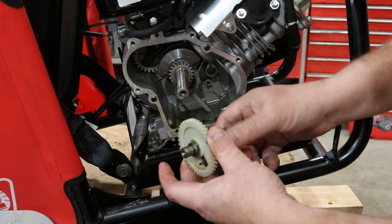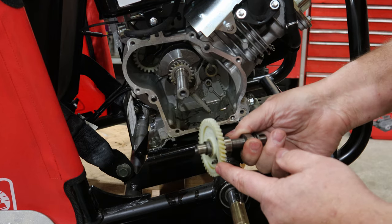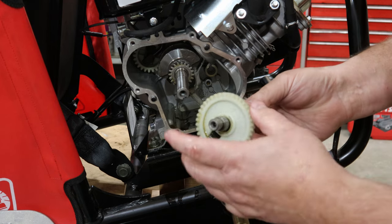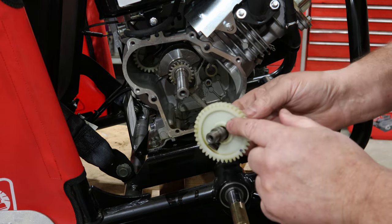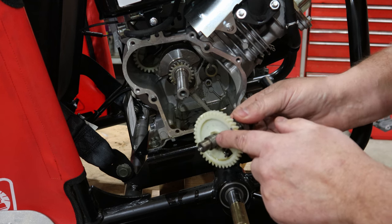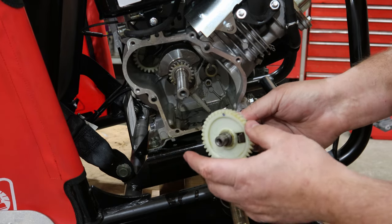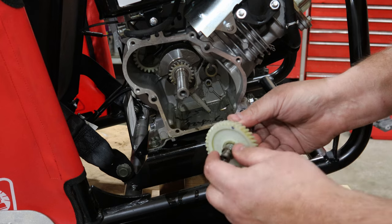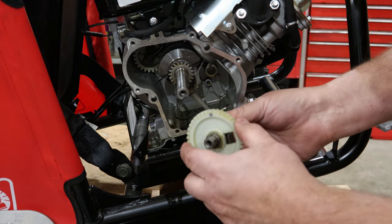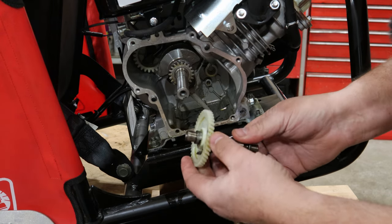We noticed, look at that. It spins inside the gear. That shouldn't happen. And I don't know how these are manufactured, whether they have to be over-molded, because there's a piece here that's probably the drive pin that's molded into this thing when this whole gear is molded onto this camshaft that sheared off. Now, did it shear off because this little piece of metal got in here somewhere, or is it just a super cheap, crappy design and just broke?